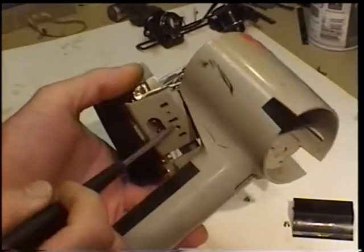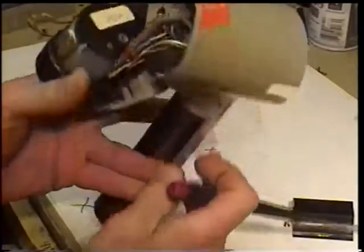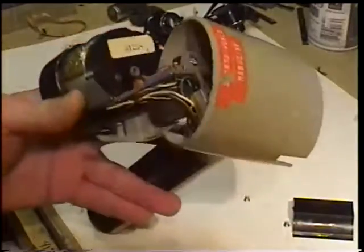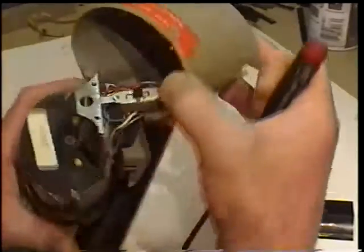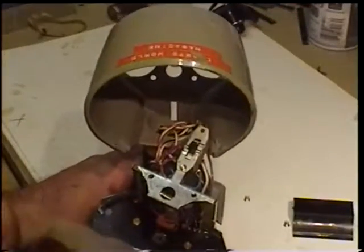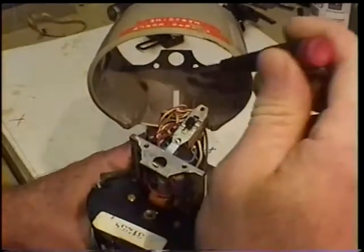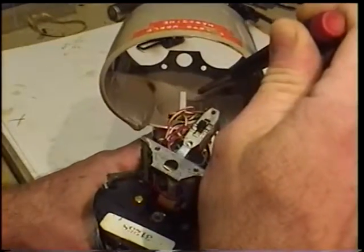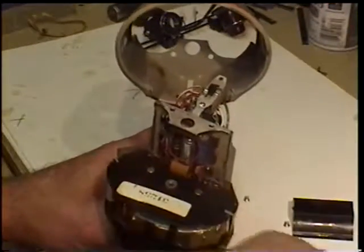You've got your plug for your PC cord, your AC cord, all this mystical, magical stuff that in the '60s was cutting edge technology. There's your switch, your coil — and I don't think you'll be able to see it from this angle — but down inside here, not sticking your fingers down in there, is the capacitor. That's what stores the charge and gives you that burst when you take a picture.